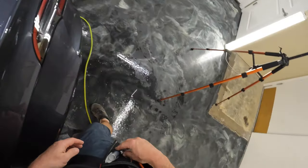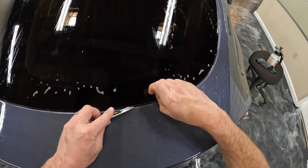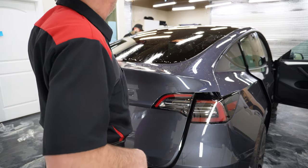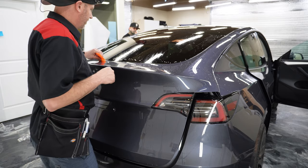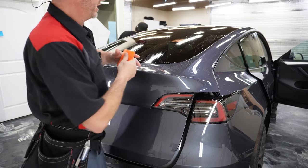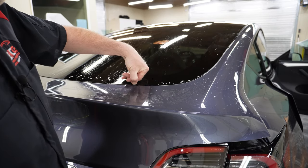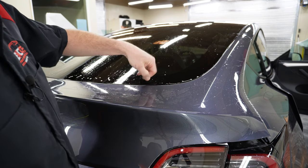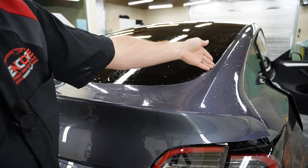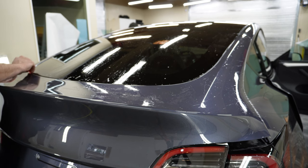Okay, let's take a look here. All right, so when we took care of this top, I went ahead and squeegeed over this edge, and I would recommend not doing that because the way that I normally do this works way better. So just leave it hanging over. Don't tuck it in. Get a blade and trim right on the edge of the glass. You can just run your blade right on the edge of that glass and cut the material, and that gives you a really nice straight line. So you're gonna have the same wrap length on everything, and then you can just tuck it right in and you don't get a jagged edge or anything. I would definitely choose that again next time.